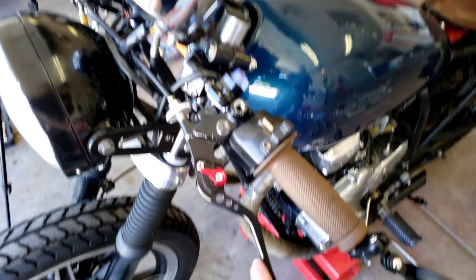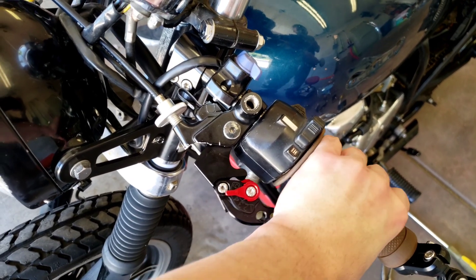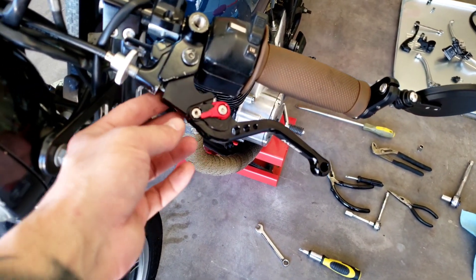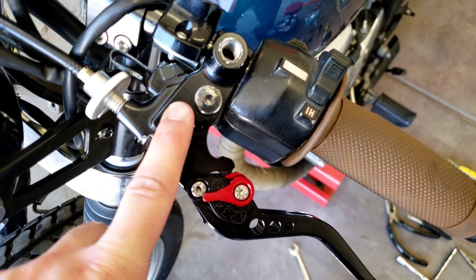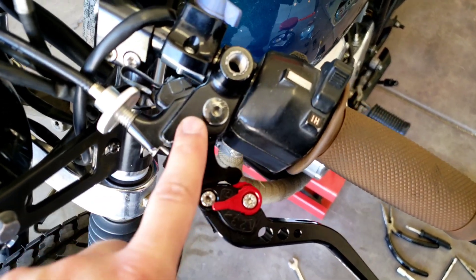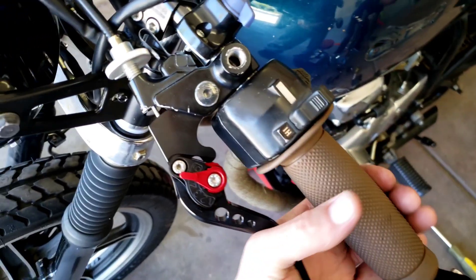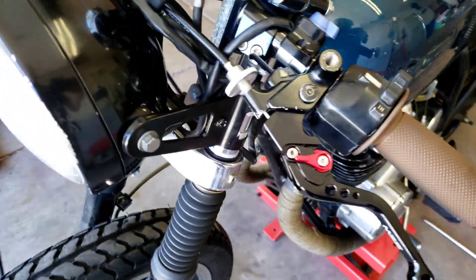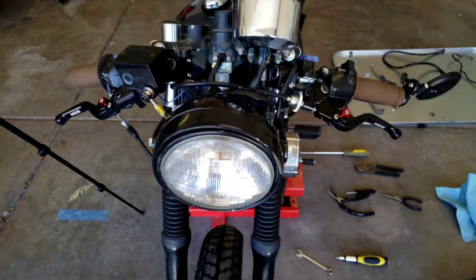We just finished buttoning up the lever. When ordering parts on eBay or Amazon that aren't OE parts, you're going to potentially run into issues. The lever didn't come with a spacer to fit the perch, even though the levers were sold as specific for the bike the perch came off of. So we had to make a spacer — it functions just fine. I adjusted the clutch down on the case to get the free play back in, and eventually we'll get a proper spacer for it.